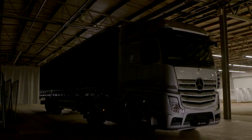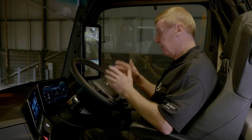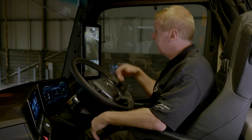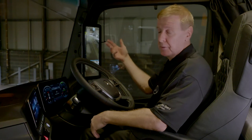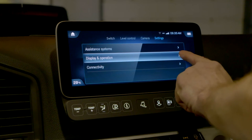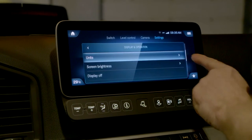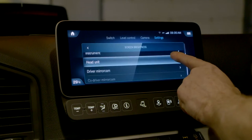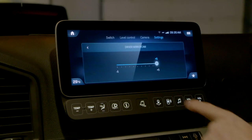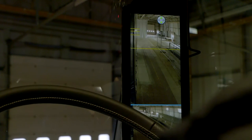Most importantly, you remain safe in the cab. On the subject of light levels: when you're in the driver's seat or operating the truck, mirror cam automatically adjusts for ambient light levels. But you can override it — go into Operation, then Display, scroll down to Screen Brightness, look for Driver Mirror Cam, and you have a sliding scroll for making it darker or brighter.